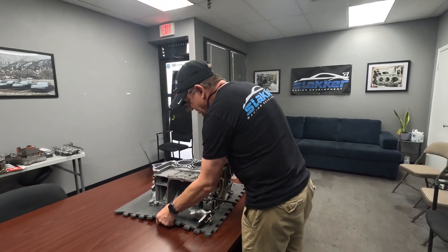Porsche designed these engines with an 83-degree Celsius thermostat, meaning it opens at around 181 degrees Fahrenheit and is completely open by about 185 degrees Fahrenheit. With normal driving, you'll see a typical running temp of around 194 to 203 degrees Fahrenheit. A low temp thermostat opens at around 160 degrees and is fully open around 167 degrees — so about a 20-degree difference in when it opens. Is 160 degrees even fully warmed up for the engine? We want the engine to get good heat in it before we push it too hard, so I don't see a big advantage for normal day-to-day driving.